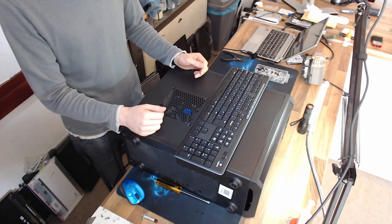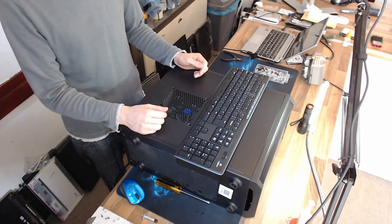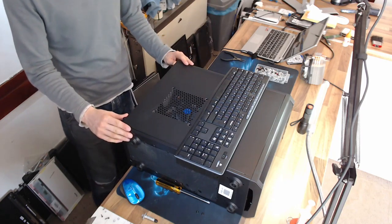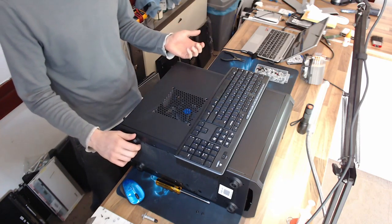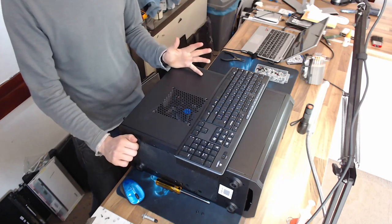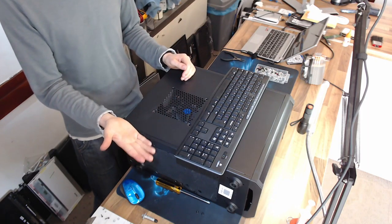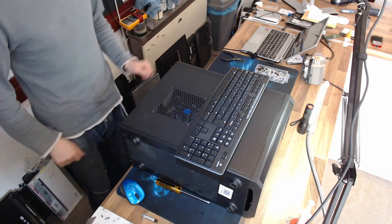So the resolution, in the end, is it just needed a BIOS reset. It's pretty wild that a dodgy BIOS setting or a corrupted BIOS could cause no power like that. No post or power cycling, absolutely, but no power, stone dead? That's something I've never seen before.